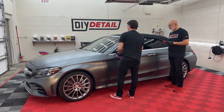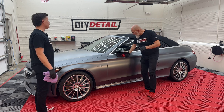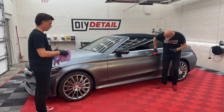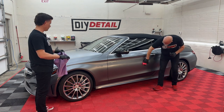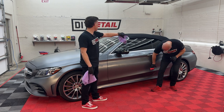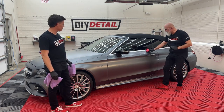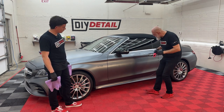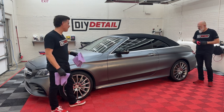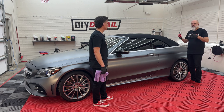Keep the windows till the end — that's what we usually do. As we've said before about coating, just choose a way to do it and do it the same way every time. That way you don't have to think about it, it becomes second nature, and you have fewer possibilities of making errors. I always start at the top left corner of the driver door and work my way around, ending on the hood. You can really see the effect on matte paint of the coating flashing or cross-linking into the paint.